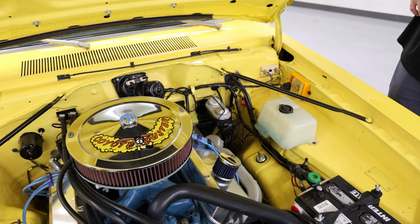The cast iron exhaust manifolds are worthy of note. They're good, high-flowing pieces, but the weird thing is, on the driver's side, the manifold looks like it's from a different car. Well, it has a high upsweep design to clear the steering box right here. It doesn't really hurt flow that much, but it looks kind of awkward. A lot of people think, what's wrong with that engine? The manifolds aren't symmetrical. Well, that's the way they were on the 340 and the 318 and the 360 cars. This one is a lightly modified car, again, electronic distributor conversion, manual disc brakes up front. That's okay with me.